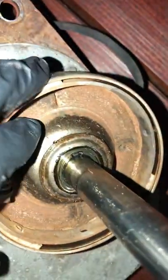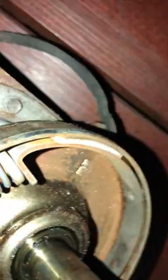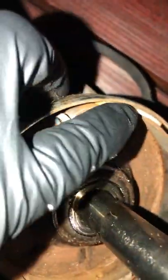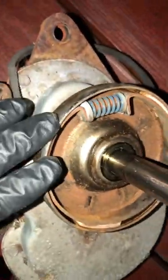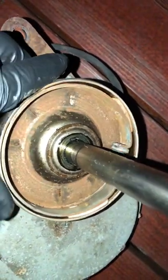You can check your clutch by holding the clutch housing and just pushing against the spring — it should be hard to turn. This one is moving pretty freely, so basically there's either oil or buildup between the clutch pads. They push against the housing, make contact, and then it does the rotating.